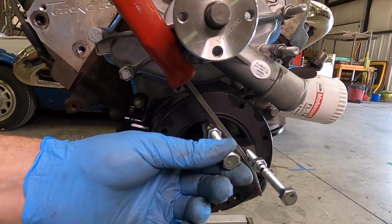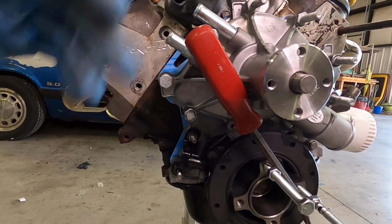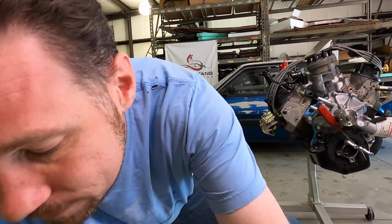So Matt has hooked me up here with these bolts, and this is gonna apply the leverage, or the back pressure, I guess, so to speak. So that's what I'm gonna do now. I'm gonna go ahead and try to get that to 80 foot-pounds. I've got my handy dandy torque wrench here, so let's go ahead, jump on that. I'm also gonna go jump into something else, and I'll explain that just in a bit.